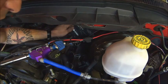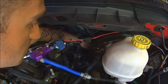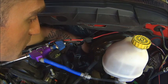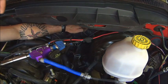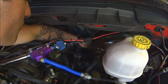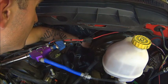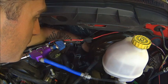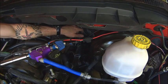Basically, I very carefully drop each plug as far as I can go into its hole. You can almost see the whole thing — if you just keep a finger on it, right into where it's supposed to go. I try to drop them carefully so I don't want to mess up the gap. If I drop it a little hard, it might close the gap up a little bit, so I'm just going to put them in nice and easy. This also helps if you have a nice cool engine, because it won't be so hot down in there.